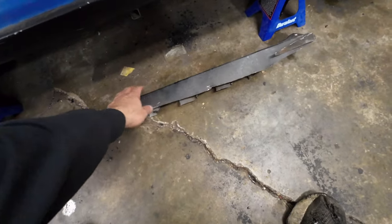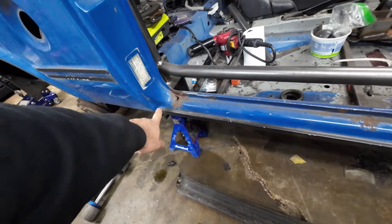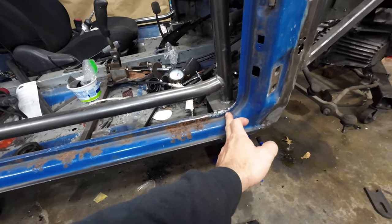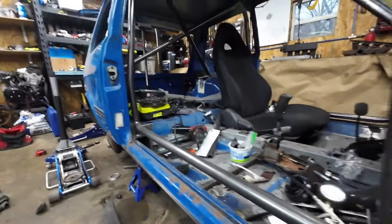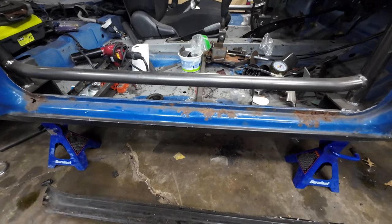I can't find a brand new piece, but I got a good used piece from a Yugo that my buddy parted out. I'm gonna cut just the top section off and replace it — drill the original spot welds and replace from here up to here. Once it's welded in, I'll use cavity wax through the hole to protect against rusting, because anytime you weld and don't protect it, it's gonna rust. I've done cutting and welding on a couple of my cars, so I'm familiar — just patience, cool it down so you don't overheat and warp the metal.